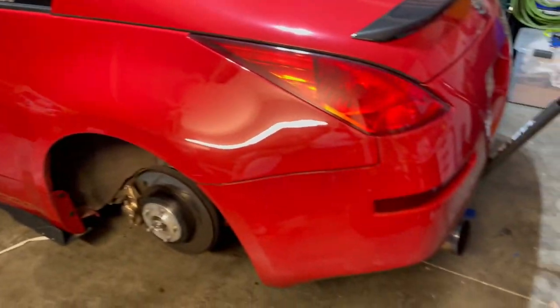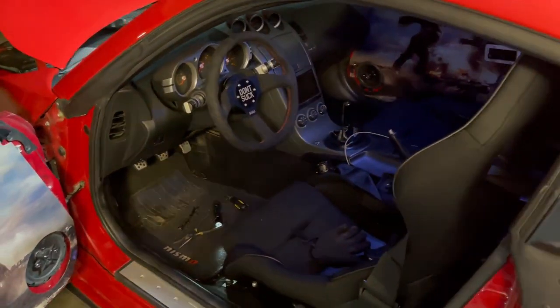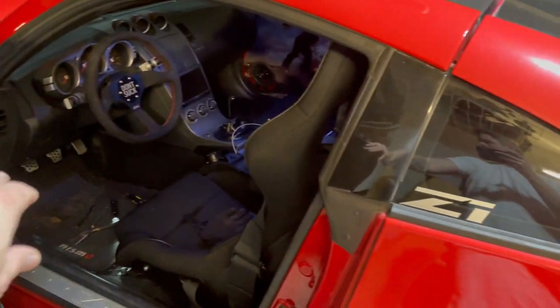It worked out pretty good — a couple of small bolts in place of those rubber bumpers. We eliminated the brake light issue. You can go ahead and replace those with rubber bumpers; I think they're like 13 bucks or something like that. I'll try to remember to put a link in the description — you can get them from Z1 or eBay. But if you've got a little hardware bin in your garage like I do, just grab a couple of bolts and nuts and stick them in there for a more permanent replacement. We've got the car up on stands now because we have a couple of long-overdue projects to take on with the 350Z. Hope you guys will stick around and follow along — thanks for watching this one, see you in the next one.